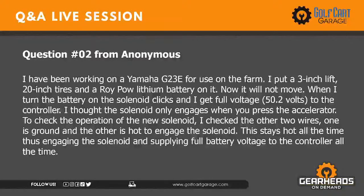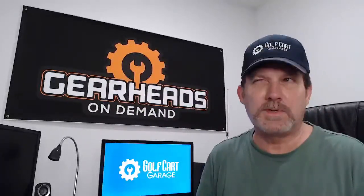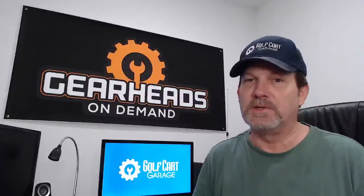To check the operation of the new solenoid, I checked the other two wires. One is ground and the other is hot to engage a solenoid. That is correct. This stays hot all the time, thus engaging the solenoid and supplying full battery voltage to the controller at all times. A G23E, okay, it's not a very common car, which is why I don't know.